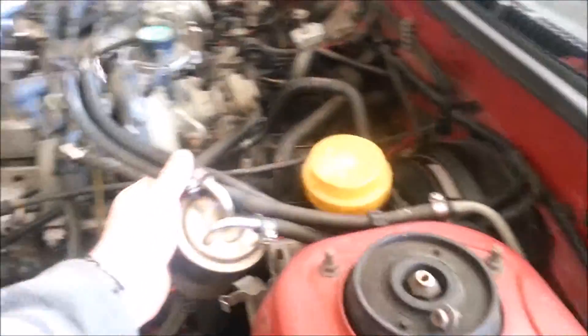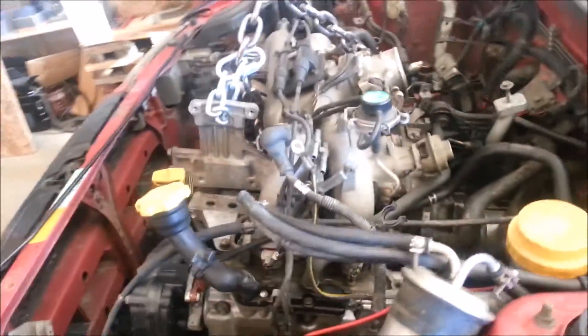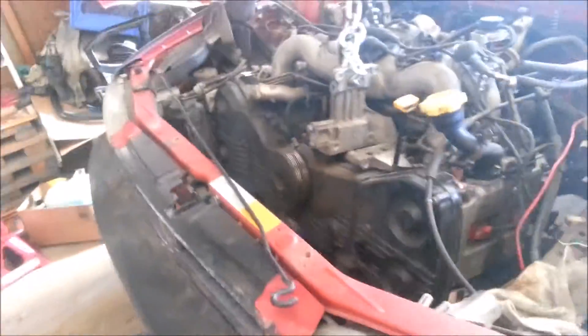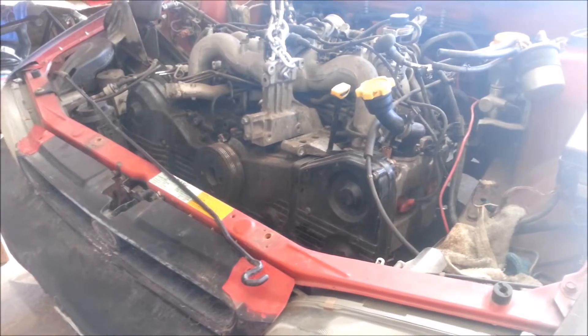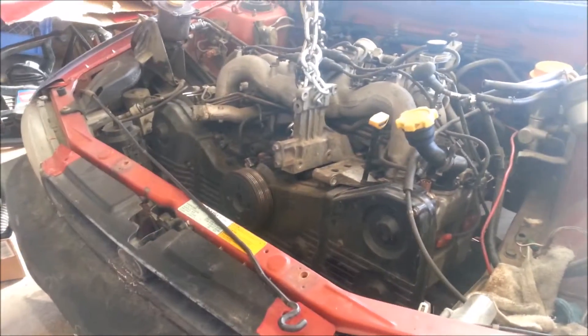This was the same exact stuff that happened on my 97 Outback that was overheating — it was behaving exactly the same way: overheating on short drives, overheating just when I run it a little bit harder. So I'm just doing the head gaskets.